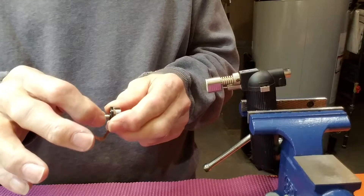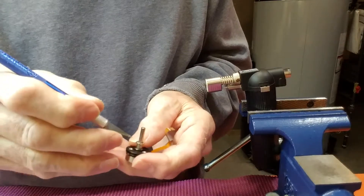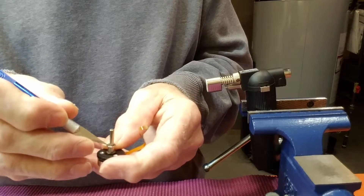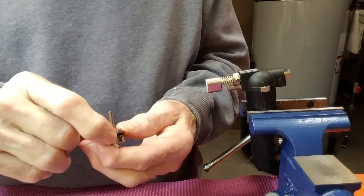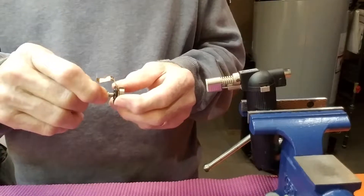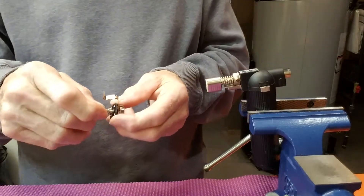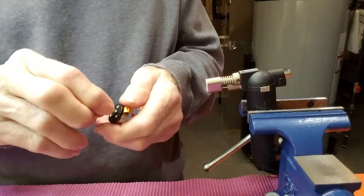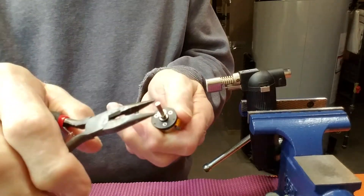Here's the yaw motor with the magnet. The next thing I do is take an exacto and make a scratch mark on the magnet — on the top of the magnet, right in the center of the flat spot — so that I'll know where that magnet started. Because I'll have to keep moving it to get it in the right position. The next thing we have to do is loosen the magnet from the shaft. They've used either red Loctite or some kind of epoxy to hold it in position. I take my finger and hold down on the ribbon cable, because if you burn that you have to buy a new one. I take a small pair of needle nose pliers and put it underneath, just like that.